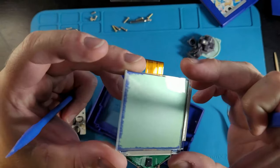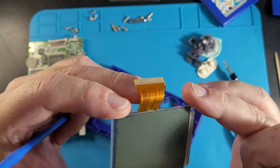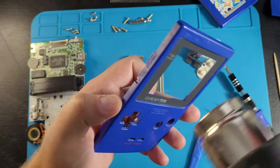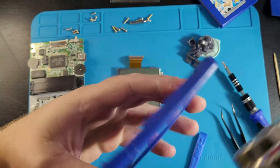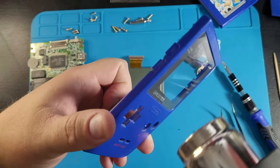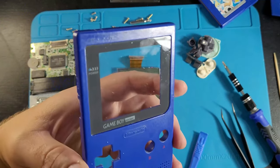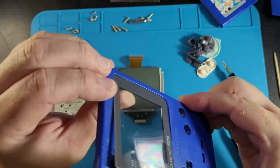When you're removing screens, just be nice with it, especially if the screen is still good. This screen is bad, and I'm going to see if I can get it fixed somehow — there's some glass on the front of this one. Not every display is like this, but this one has a glass cover, a bit of a different design. For taking off the front piece, we're going to add some heat on low — I have a heat gun here — and basically this front cover display is gonna peel right off easily. Don't push too hard if you want to keep this cover. I suggest getting a new one on AliExpress, but for this video I'm reusing this one.